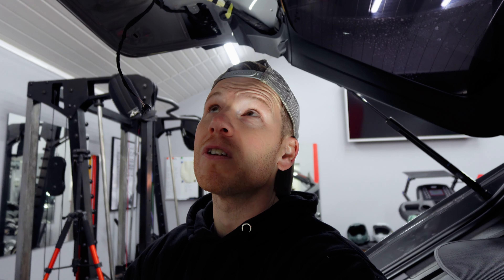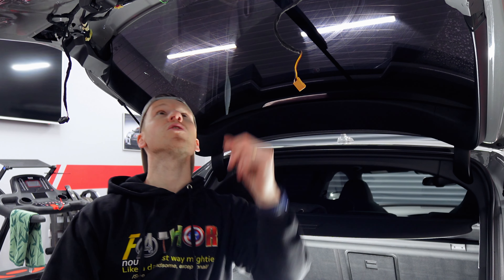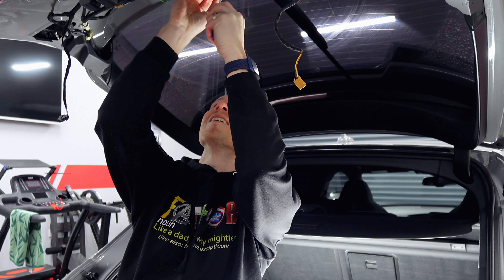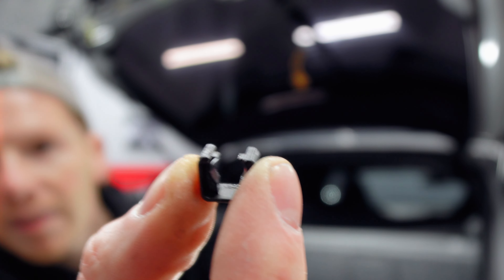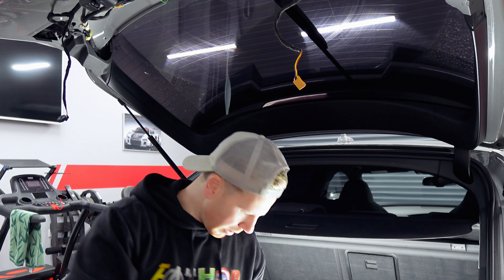When I take this end bit off, I'm just hoping this pipe is blocked here or blocked there. If it's not, that's very bad — that means somewhere in here there's a puddle of washer fluid. I'm just in the boot now and I'm going to see if I can get this pipe off. I've also just taken off this little plastic clip there.